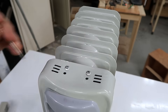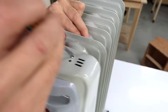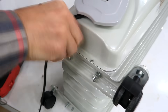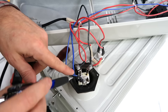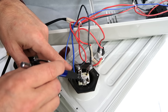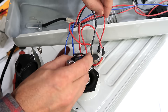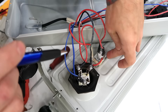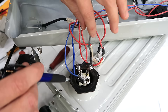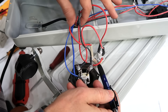Let's pop this one open — it's got security screws to keep me from opening it. What we've got in here is two heating elements: one between these two pins and one between these two pins, and they're tied together here. Level 1 goes straight to the thermostat up here. Level 2 goes through this overheat protection to the thermostat, so if it overheats this cuts it out. Level 3 connects both of those together at the same time. There's also this thing here which is a thermal fuse that cuts out the power as a whole — if that one trips it won't come back.